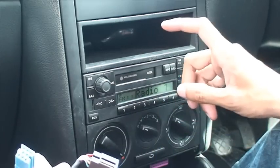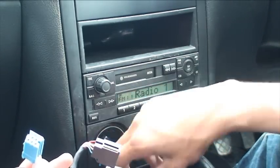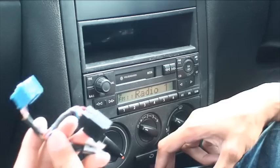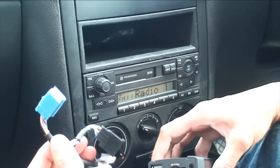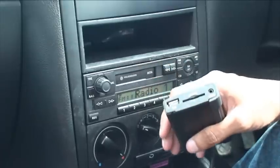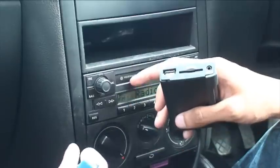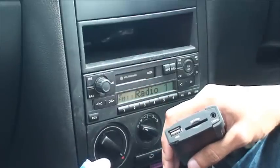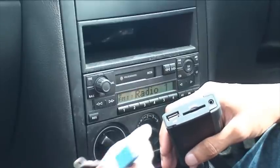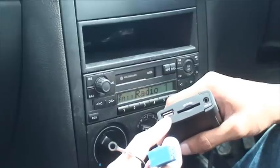As you may have guessed, the head unit has a CD changer plug at the back of it. We're not going to be using a CD changer. So all we're doing is plugging this unit into the CD changer port at the back. As far as the head unit is concerned, it thinks it's got a CD changer connected. Then you plug in your connectivity options and it plays them as if it thinks it's a CD changer. So you can add your music to the SD card or USB connected media — it could even be a hard drive as long as it doesn't need another power source.